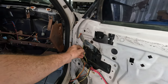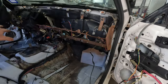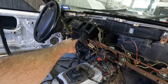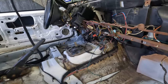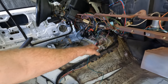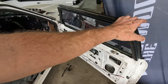The power mirror wires were pinched a little bit, so I'm going to double check those. The switch was bypassed because they had that custom weird switch set up in the bottom side of the cluster housing. We're going back to normal armrests now that these door bars are no longer in existence. I've ordered a radio harness kit to fix a few of these cut wires, and got some Dorman door lock actuators, so we'll get those installed.